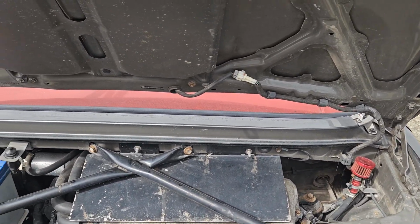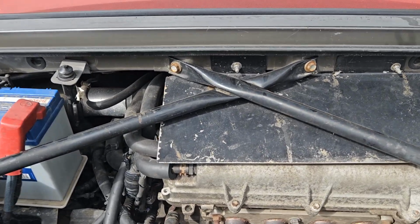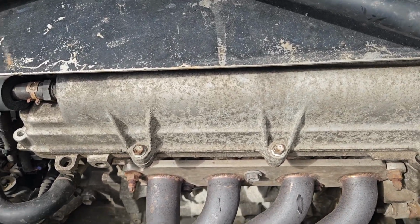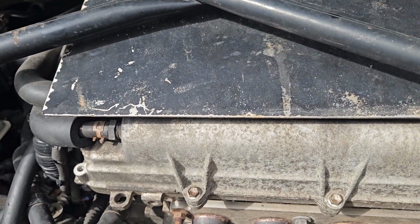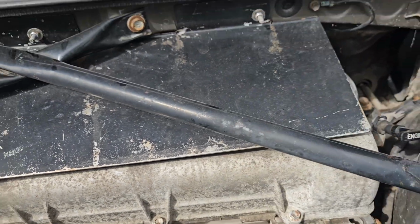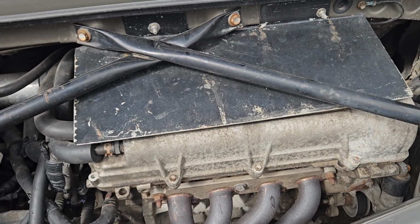On the facelift, they upgraded the piston rings, I believe, due to oil burning issues from the pre-cats breaking down. So there are some slight internal changes between facelift and pre-facelift engines. I don't think there's any real external way of checking which one you've got in case someone's changed it. Someone might be able to tell us, but I don't know off the top of my head.